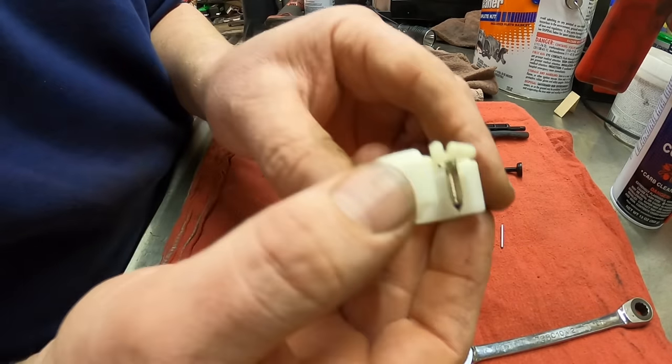I know that one was clogged up. I will clean these up and I'll spray gum cutter through it to make sure that all the passages are open. And it'll kind of blow out like a fountain, and then I'll take compressed air and do the same thing. I don't want to do it too close to the camera. I already started melting my camera.